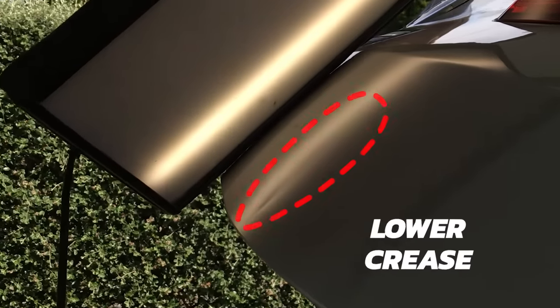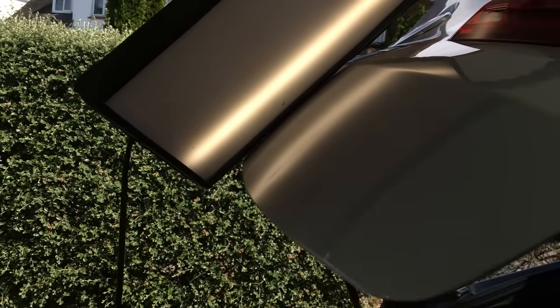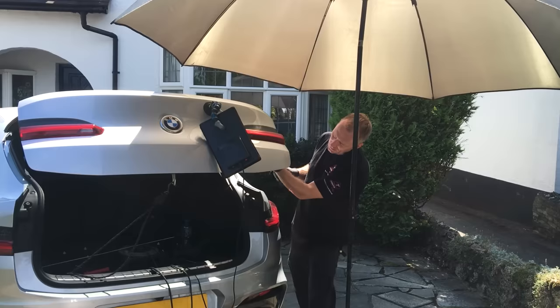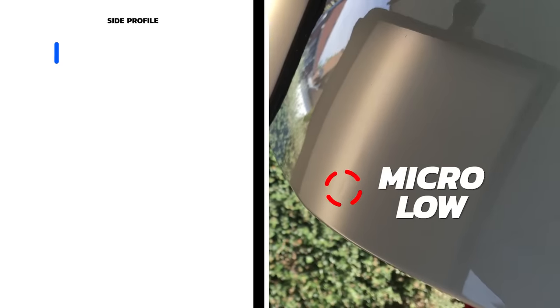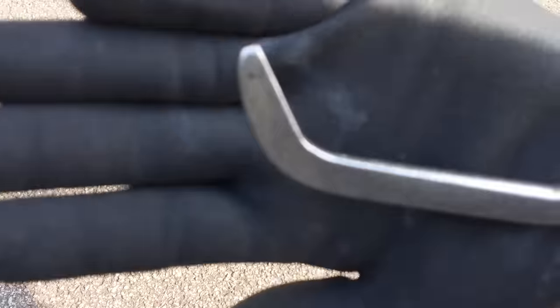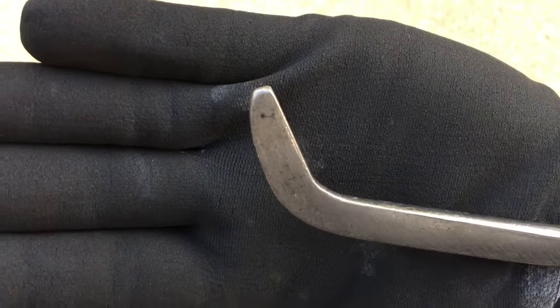Now it's time to move down the panel and concentrate on the low section going into the edge of the frame. To repair this I start with my plastic vinyl tip, threading it through the hole at the back and navigating the bar down to push this low area out. It's working on the upper part, but I'm struggling to get into a little micro low at the bottom of the panel because of the shape of the inner frame. To get down this far I switch to my standard double bend shave tool. The shave tip allows me to get down into this lower section and remove the micro low — and there you go, it's completely gone.